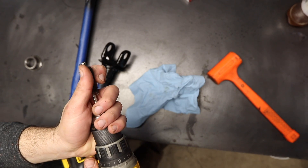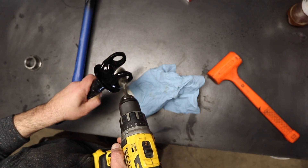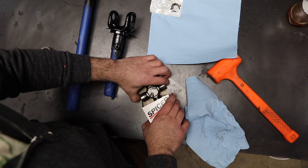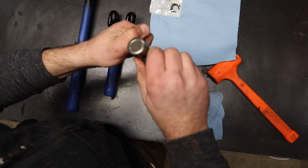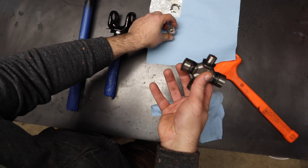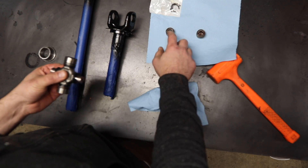If you are painting your axles like I did, you might get some overspray in these bores and you want to clean that up pretty good. When you buy the U-Joint kit, you get the four retainers and the U-Joint itself. These caps come off — they have to come off for the install — and they're filled with these needle bearings, which I call Satan's children.